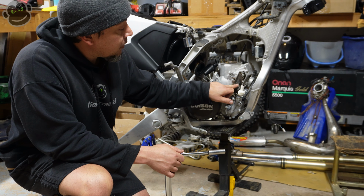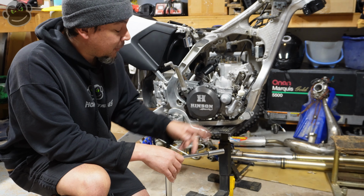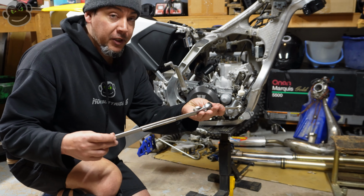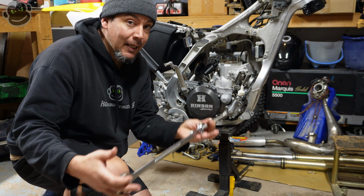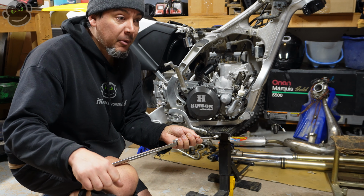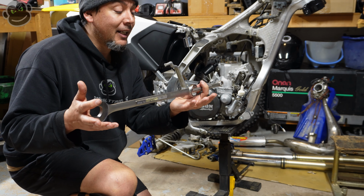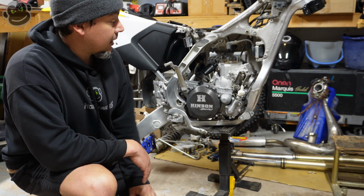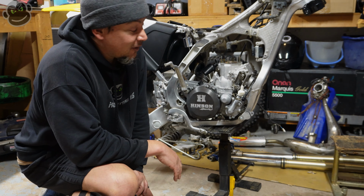I don't know how you can torque these with a torque wrench. Maybe they make a torque wrench that can fit in here, but I don't know of one. So what I do is I get my 14 millimeter, for this bike, and a wrench that gives me the same length as my torque wrench. And then after that, it's just kind of feel. I try to feel how much leverage or pressure I'm putting on the torque wrench, and I apply the same amount of pressure with a wrench of the same length. That's how I get the two back nuts, because I don't know how to get those with a torque wrench. So if anybody else does, leave a comment down below, because I could use some help there.